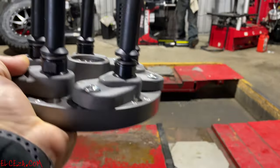Okay? So, with that said, when we take the weights off of them, we should be taking the weights off over here before we mount and balance them and mount them over here. But a lot of times we don't. We bring them over here, and then we don't take the weights off until we get it choked up, and then we scrape the weights off, and it hits right here, hits the toe of my boot, goes right underneath the machine. And then we get down on our hands and knees with our magnet and dig them out, right?